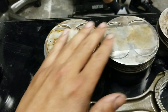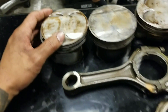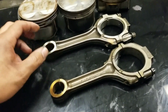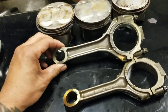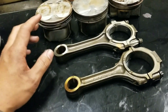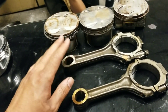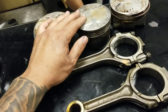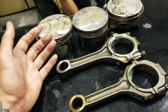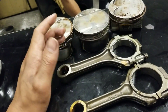Supposedly those pistons in size and dimension are exactly the same. But why is HR faster? Because of the rods. This is for DE rods and this is for HR or VHR rods — you can see the VHR and HR rods are way stronger, way better. The HR uses these rods which give the piston more stroke, so the HR probably makes less torque but higher horsepower due to having more stroke with the same size piston.